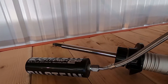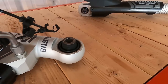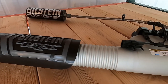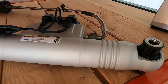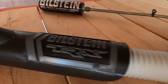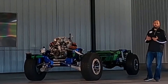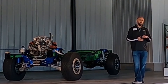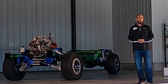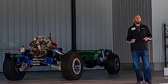To control all of this suspension, we have the Bilstein Blackhawk E2 damper system. These are fully active — we have actuation of both the compression and the rebound side of the dampers. Very massive, robust units. They're capable of adjusting anywhere from 22 pounds to 1 ton per corner — massive forces to help us deal with the loads when you're driving at max attack through the dunes, but also when you'll be jumping on the track. We control them through our proprietary Active Terrain Dynamic system. There's a ride-height position sensor at each corner and three accelerometers on the frame. We know exactly where the tire is in travel at all times, and we know exactly what the platform is doing — whether it's heaving, pitching, or rolling. We can adjust the dampers within one millisecond to counteract that behavior.